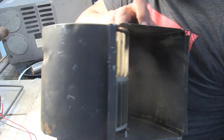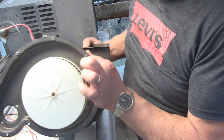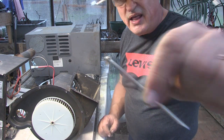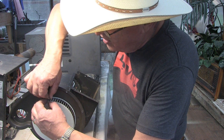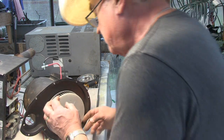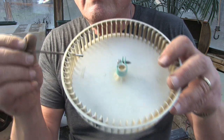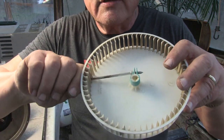The motor is down inside of there, and we have to take this fan off. Then we have to loosen a screw down in there to get the motor out. We're getting close. To remove this fan, you need a good length on an Allen wrench that's going to fit the little keeper. You have to have it long enough to reach down in there. Try not to force it too bad because this is plastic and it can break. You have to get the Allen wrench long enough to fit down in there and get a hold of that little Allen head screw that tightens the keeper to the shaft — that's how you do that, and that's why it needs to be long.